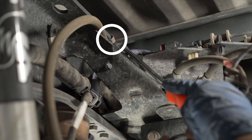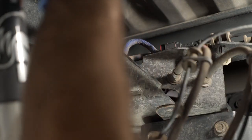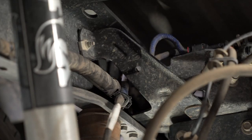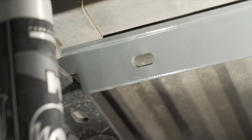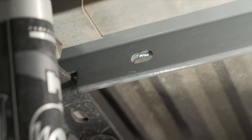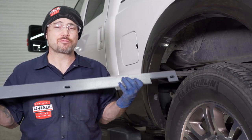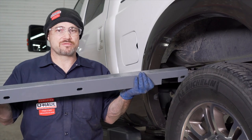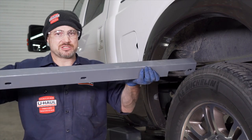If you're having trouble sliding the rear cross member all the way rearward, this vacuum line clip may be in the way. Go ahead and pop it off the frame rail so we can slide the cross member back, then replace it. Make sure you have inserted the cross member in the correct direction — elongated holes should be facing the cab, and the bracket with no holes will be underneath the truck bed. We are now ready to place the front cross member. The elongated holes are going to face the rear of the truck as we lift it from underneath.